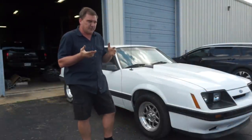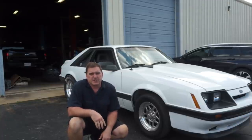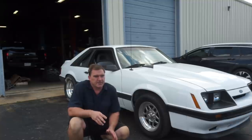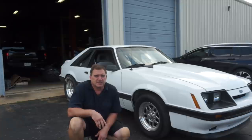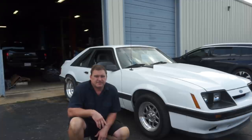Thanks for coming along with us on this alignment and fuel tank install. It wasn't a whole lot to the fuel tank install — it was pretty much a straightforward bolted change-out. Made a couple of fuel lines, rerouted some fuel lines, put in a couple of extra bolts on the rear coil overs, and raised up the back end with the coil-over adjustment a little bit. Everything's all squared up and nice and true. My bump steer kit worked out great. She's going to take it to Florida this weekend, so we'll see how she likes it. We'll get some feedback on what it does and how it does it, then maybe we'll make some tweaks from there. Right now it's square and true so it should drive nice and straight, which is what you want. Thanks for watching — click like, subscribe, leave some comments below. You guys have a great day. See you on the next one.